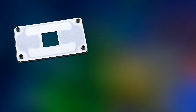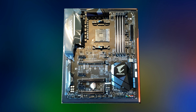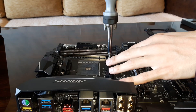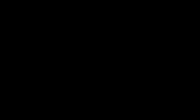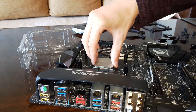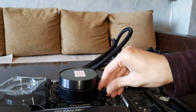This is all for the unboxing. Let's start the assembly of this CPU. In order to install the CPU, you need a backplate and a retention plate, which has to be AM4. If you're gonna use an air cooler, do not remove these plates from the motherboard. However, if you use liquid cooling like myself, you need to remove them. Place the backplate on the back side of your motherboard and screw it in. Lift up the locking mechanism. Take your CPU and align the triangle shown on the motherboard to the triangle on the CPU. Gently place your CPU in place without adding any force to it. Once it's in, lock it down. Place the cooler down and screw it in.